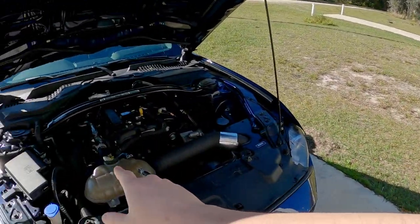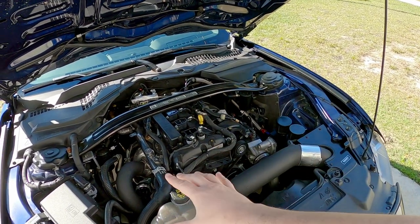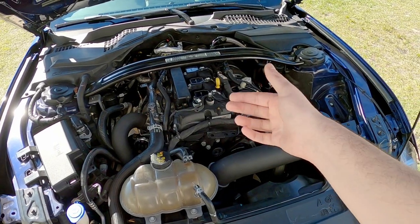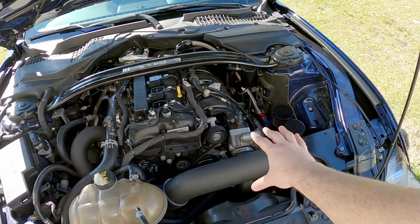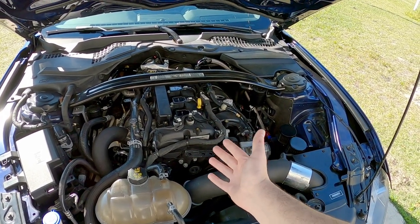I feel like I'm working against myself. If I go back to setting the wastegate actuator arm where it was when I first started logging — which still isn't technically correct — the car was actually doing everything it should have done. I could probably set it back to that position on the stock calibration, then make changes to the overboost thresholds so it doesn't throw an overboost fault, and I bet this thing would run perfectly fine without any boost spikes.